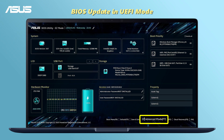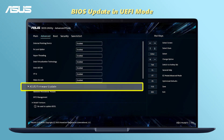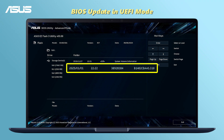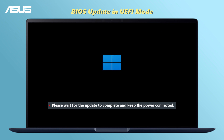If you're using the UEFI interface, go to Advanced Settings, then enter ASUS Firmware Update. Select the BIOS update file from the USB drive. Confirm the update by selecting Yes to proceed. The BIOS update will begin, showing a progress bar with multiple restarts.